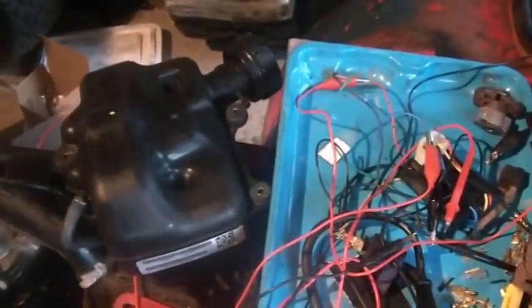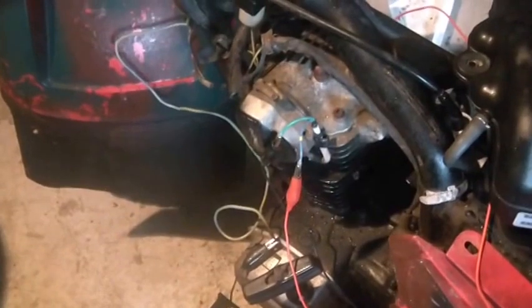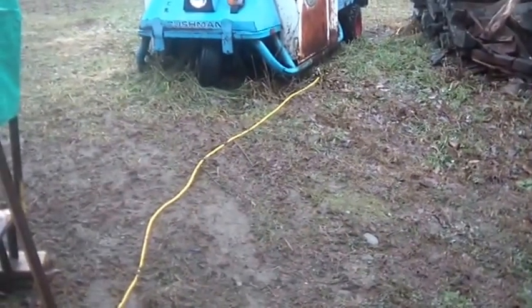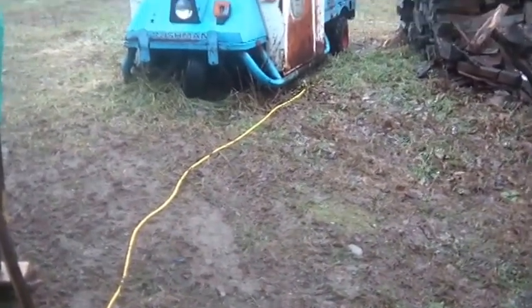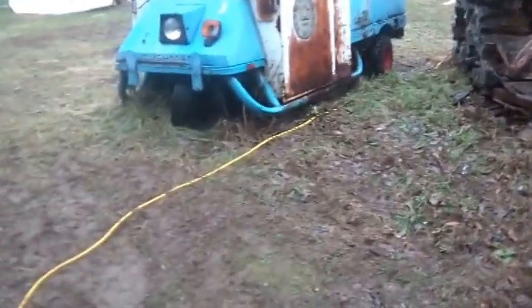Anyway, the bench test works and now the concept on a bike works — I put a DC CDI on and got it to run on a Honda 250 SX. All right folks, live, love, and have a great time. We'll catch you on the next episode of the Hoard. Remember to keep your tires down, your tracks down, your handlebars and steering wheels up. Thanks to all for watching, subscribing, and commenting, and thanks to William Staten for some of the help on the CDIs — if he hadn't said 'your CDI looks a little too small to be a DC unit' I would have really been scratching my head, because it wasn't drawing any power and I wouldn't have known where to get the right ones.